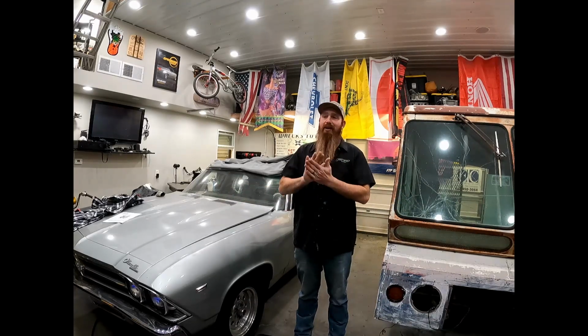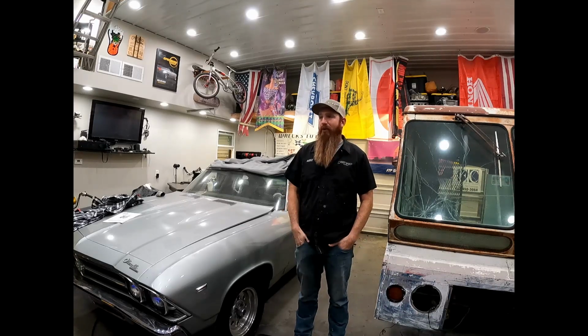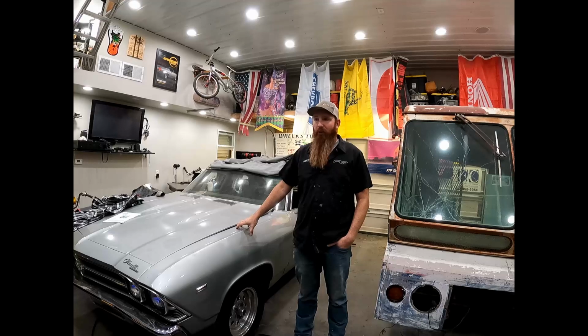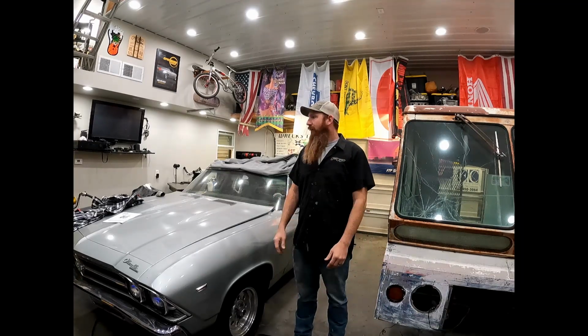All right, guys, it's gonna be a wrap for this one. As you saw, the Chevelle summer motor spun a cam bearing, which really sucks because that took out our BTR Stage 3 blower cam. So we're gonna have to get a new cam for the Chevelle's forged motor once that starts going together. Hoping that the block is not hurt. It probably is trash, but I'm hoping that maybe it can be saved. If not, we do have the crank that should be good in there. I have another 6-liter crank. I'll probably end up getting a set of forged connecting rods, and maybe a set of forged pistons for the snail mail motor. I don't know, that's still all up in the air.